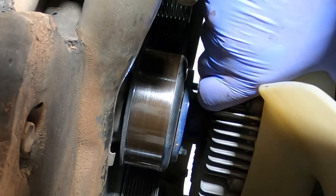The belt routing goes: alternator, idler pulley, water pump, AC, fan pulley, crank, and tensioner. One handy thing to do while the belt is off is give each pulley a spin and check for bearing noise. The brand new water pump is obviously going to be perfect. Air compressor feels good, fan feels good, tensioner feels good — that's a reasonably new tensioner. Idler pulley good, alternator good — that's been replaced recently. And of course you can't spin your crank pulley.